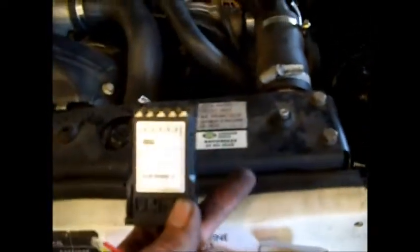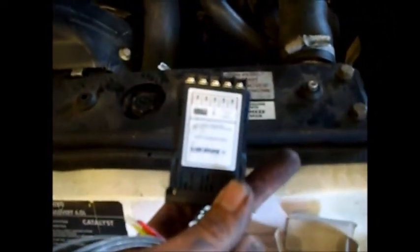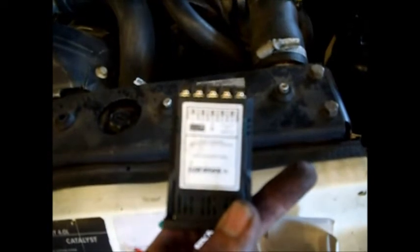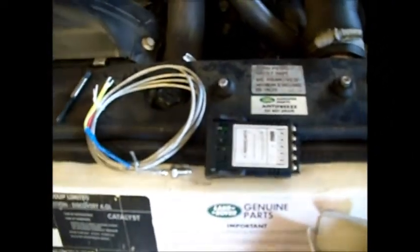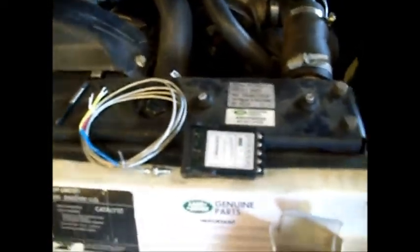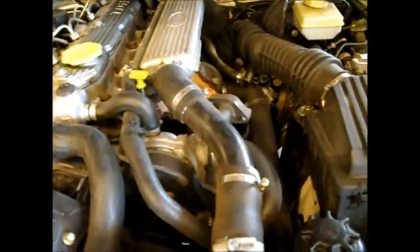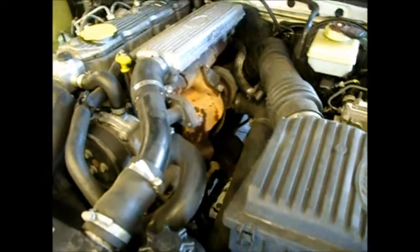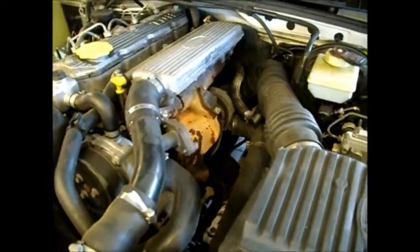What's neat about this thing is that you can use a switch so that it'll sound an alarm when your EGT gets too hot. EGT of 1350 degrees Fahrenheit is too hot, so you're going to want to be alerted if you over-temp your engine. This is particularly important if you're going to do some tweaking on your fuel control, which I have done. I also anticipate installing a CNG — compressed natural gas — injection system. It'll boost your horsepower, but you've got to be very careful that you do not burn up your motor.